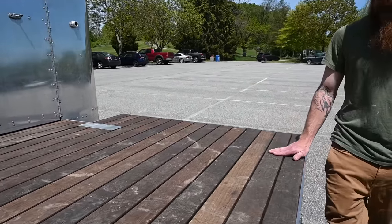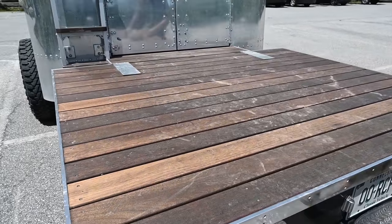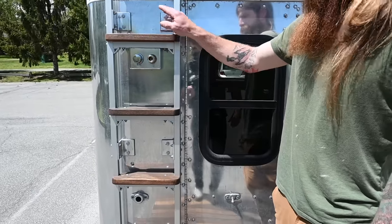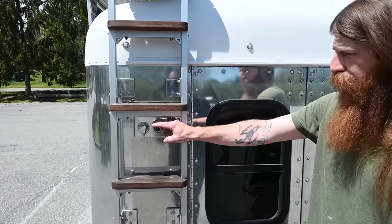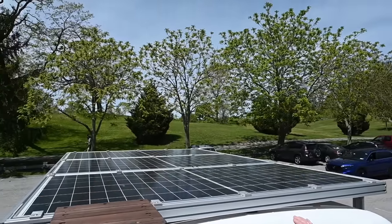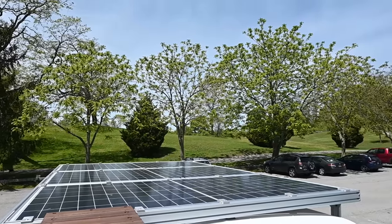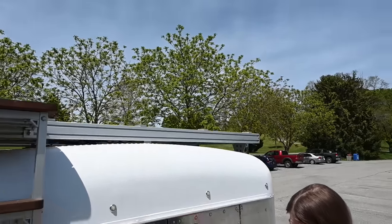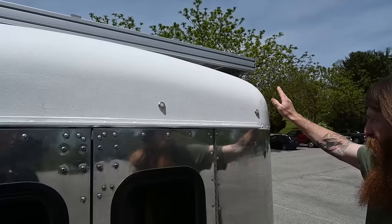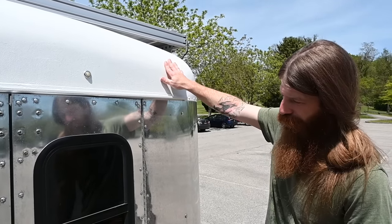All of the woodwork on the outside is mahogany decking going all the way up through. I have a ladder and an outdoor water spigot with hot and cold valve. On top, I have 1,100 watts of solar across the whole roof, and I built the whole roof rack out of 8020 15 series. After restoring the van, I did multiple coats of Raptor liner and 3M 5200 to seal all the roof penetrations and all the aluminum panels original to the body.